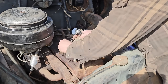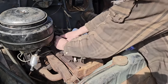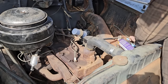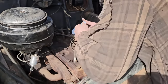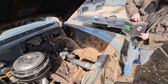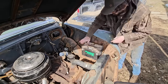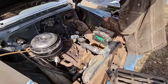And now we're gonna just pull the spark plugs out to see if any water made it past. And we had a good look inside there, and it doesn't look like anything got inside the engine. But that doesn't change the fact that it's not wanting to spin. But I do recall that the previous owner said that the starter is now ruined. So I thought maybe there's some chance that it's just jammed up against the flywheel. So I figured I'd throw a battery in it and see if we could get the starter to do anything at all, see if it'll magically free itself up. At this point, I was still rather foolishly optimistic that this wasn't going to turn into a 2 or 3 day debacle. I thought it was just going to magically go, seeing as how it was running recently.